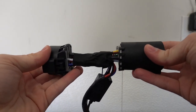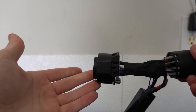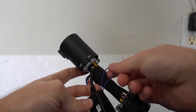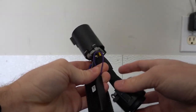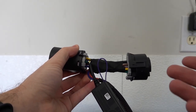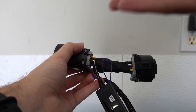Here's the harness that comes with the kit. It is a very short jumper harness — the larger end plugs into the factory wiring that comes into the back of the hitch on your vehicle, and the shorter end will go back into where that plug came out of. This is just providing power and the jumper to go to the Diode Dynamics pod from the factory wiring. There is a purple wire here on a small waterproof box — if you leave this intact, it will enable the flashing brake light function, which flashes in quick succession when you first hit the brakes and then goes solid. If you don't want the flashing function and just want it solid every time you hit the brakes, you'll need to cut this wire and tie up both ends, which will enable the brake light to function like a normal vehicle.